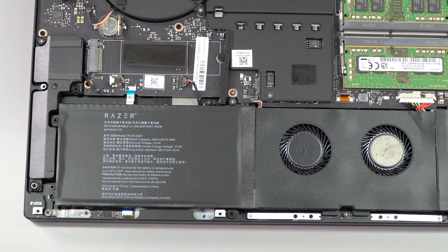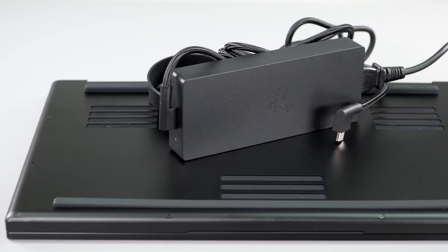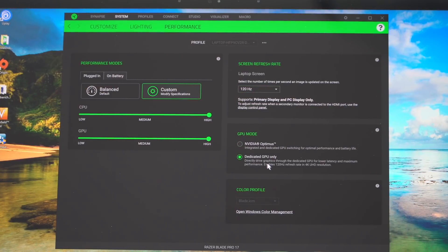Battery life: it has a 70.5 watt-hour battery and comes with a 230-watt charger regardless of the model you pick. In the Razer software, you can set it to either always-on dedicated graphics — which typically gets you better frame rates — or NVIDIA Optimus switchable graphics with integrated graphics. We run our battery life tests on switchable graphics for better battery life. That's not a super huge battery given the power in this laptop, and it's about a five to five-and-a-half hour laptop. The 4K display gets inordinately bright — they claim 400 nits, but we measured 478.